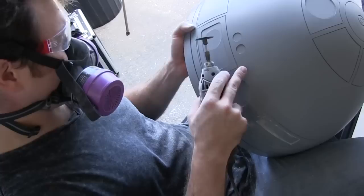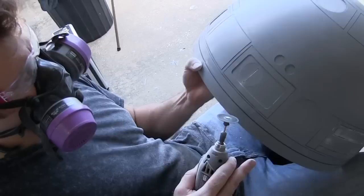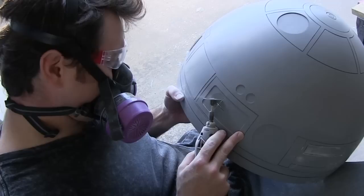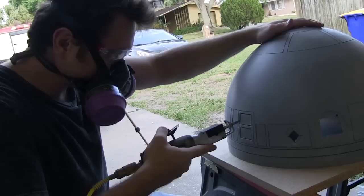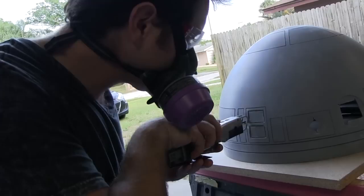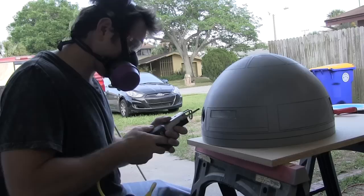Please note that Austin is wearing safety glasses and a respirator. You really don't want to be breathing this dust in — it is bad juju for continued existence on planet Earth. It can also be irritating to the skin. Some people have a reaction to it. I tend not to have too bad a problem with the fiberglass dust, but you could wear gloves. Right here I'm using an air saw — a pneumatic reciprocating saw — to cut the edges to clean up the corners. This would have been just as easy to do with a hacksaw blade stuck in the openings.